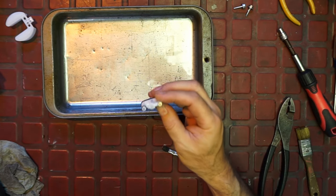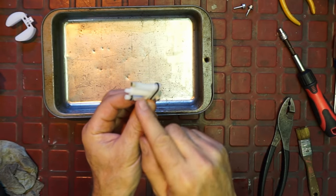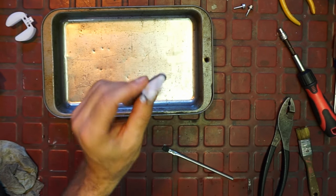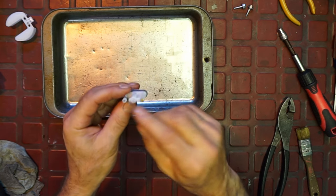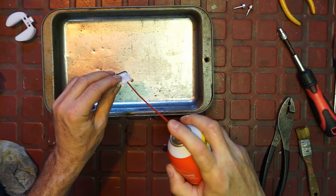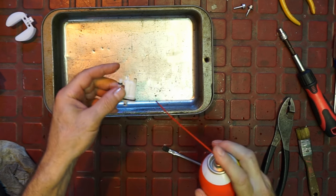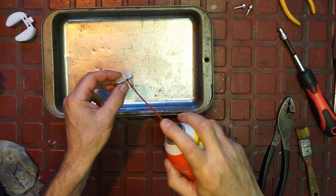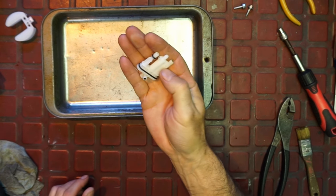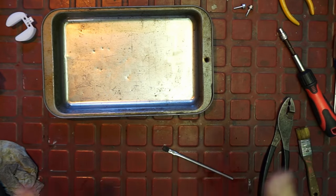Now lastly, they do sell this part — you can replace it. I've had pretty good luck with cleaning these. If you hold it up to the light, you may see something inside. If you've got a lot of debris in there and it's really inhaled a lot of debris, that's a case when you're going to want to replace it. But try cleaning it first. We're going to be quick about it — we're going to blow in through these jets. That's why we're not going to be soaking anything. Let me blow it with the air. Done. Now let's put this thing back together.